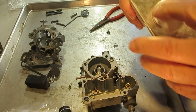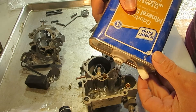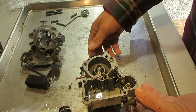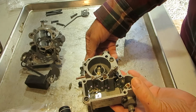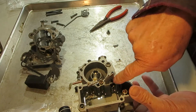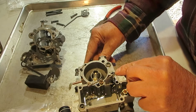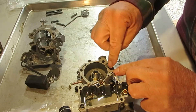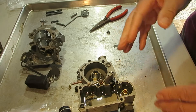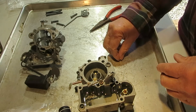I'm going to do some testing here. What I use is some mineral spirits — I'll fill the bowl up mostly. When I pump this you can see right away gas went into the accelerator pump well, and then when I pumped it it came out right here through the main discharge. If the top was on it would force it through that little hole. So we know that part is working — gas is coming out. Now let's put the check ball in there.